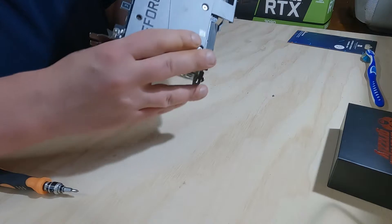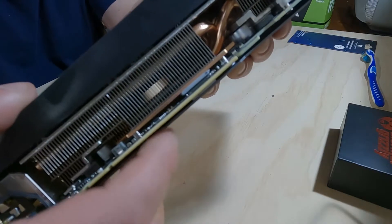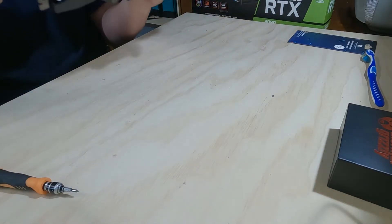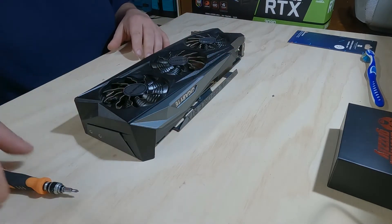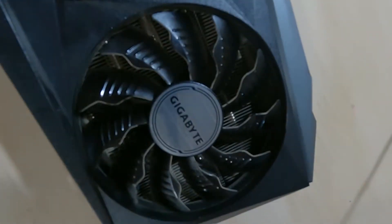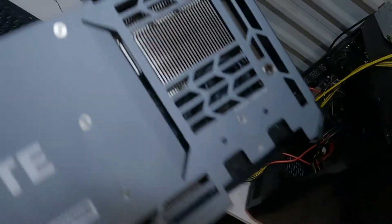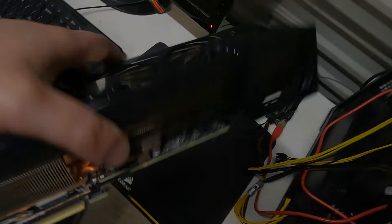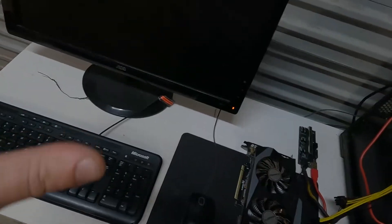The card's back together. You're probably wondering why I didn't do the thermal pads on the back plate — under the back plate there are actually thermal pads already on this card. So this card already comes with thermal pads on the back plate, so I'm going to leave them on there. We'll see how much we're saving on the temperature anyway. So we'll get the card back over, get it plugged in — hopefully we can get this thing below 100 degrees Celsius on the memory junction. That's my main concern. We'll get it plugged in, get the computer on, and give this card a quick test.